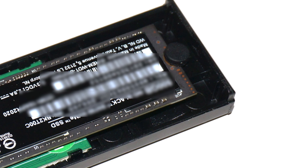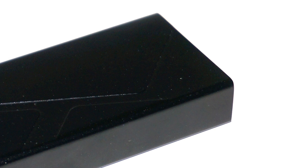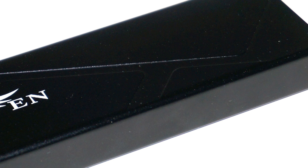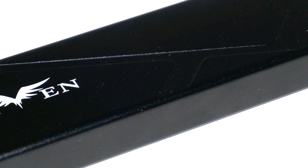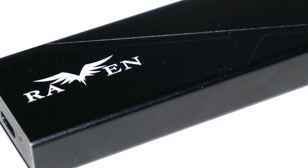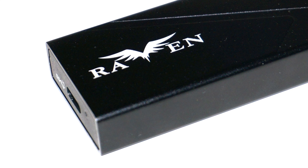Well, you can just put the old one on a shelf and forget about it. The other option is to buy a SilverStone RVS-03 and make a portable storage device using the standalone M.2 SSD. One good thing about the RVS-03 is it can support both SATA and NVMe M.2 SSDs, so you will not be disappointed if your old SSD is SATA 6Gbps based.